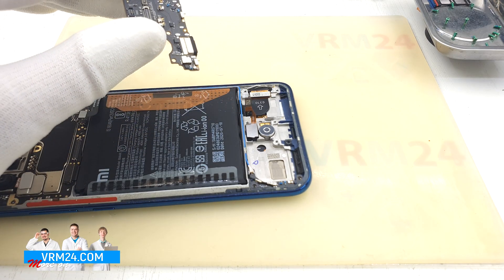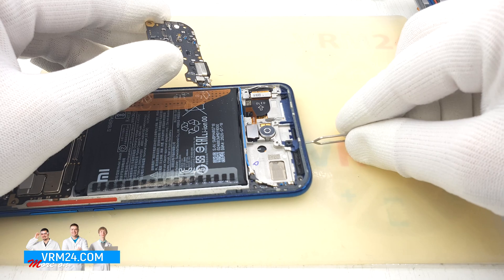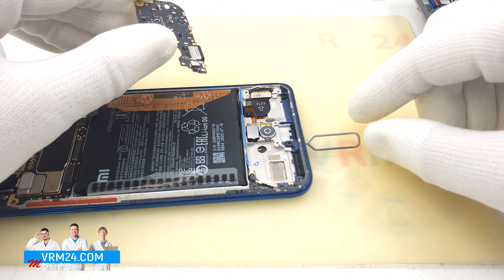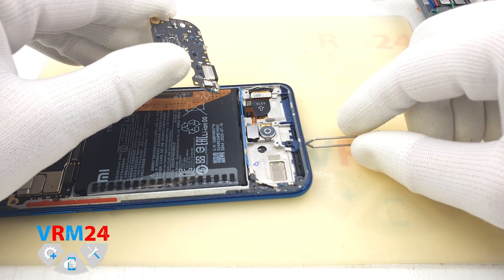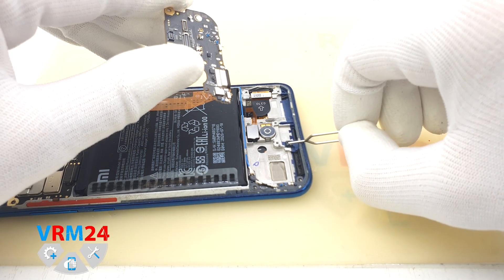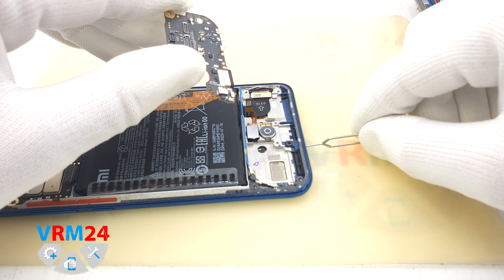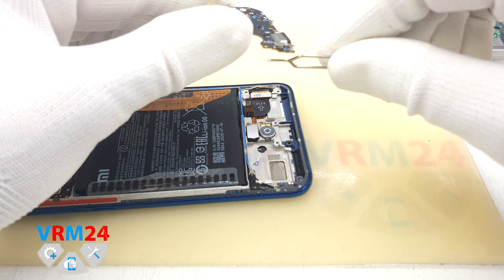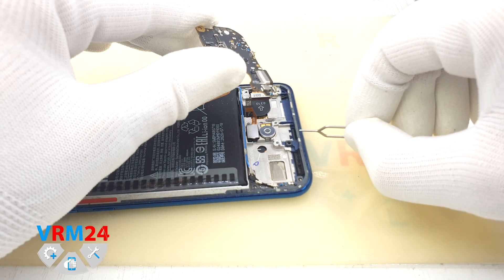I want to show you how the microphone is located — on modern models they do it smartly. If I put some instrument into the microphone hole, there is no net and you can push the instrument deep. This is intentional: the net is on this side and the microphone hole on the subboard is perpendicular to the hole in the display frame. The microphone is actually on the other side of the subboard, which means that whatever you push in there, it is almost impossible to damage the microphone.